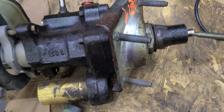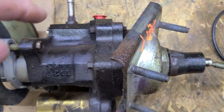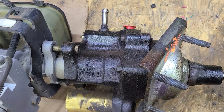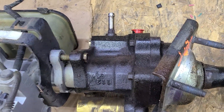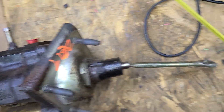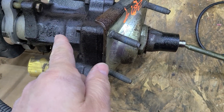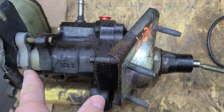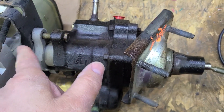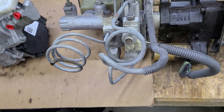So this is all metric. And then they're using the Hydro Boost system, which runs off of the LS1-style or really any kind of power steering pump. Essentially what happens is when you push on the brake pedal, it pushes the rod in, opens a little valve, and the approximately 2000 PSI from the power steering pump basically pushes harder on the piston for the master cylinder. And that's how you get your extra assist.